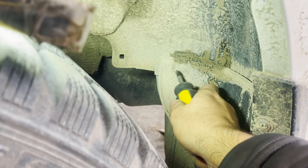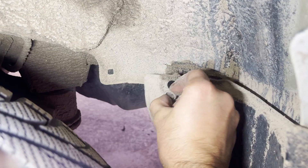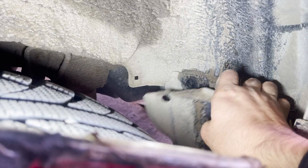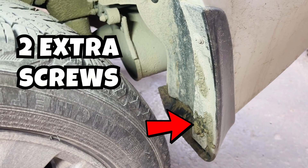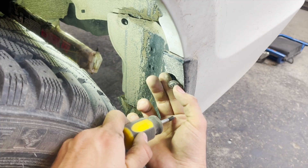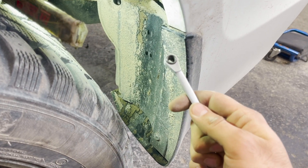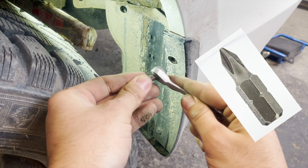Jumping onto the corners, we will take out the first screw from the inner side. This screw is actually part of a cover — in order to take out the rear bumper we need to remove this cover, which involves taking out two extra screws. The bottom screw has a tight spot because of the rear tire being there, so we will use a small wrench along with a cross bit to remove the bottom screw.